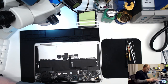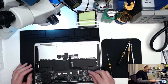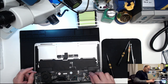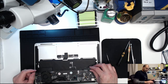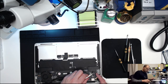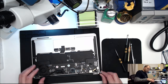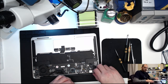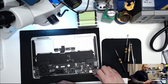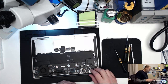Take the battery out - we'll be transferring it to the new top case. Pull your trackpad cable - there's a little latch you just lift up, same on the trackpad side. Lift it up, pull it out, set it aside. Undo your keyboard backlight cable the same way - flip the latch up and pull the cable out. Your right speaker is plugged in here, so unhook that. Then you have your LCD connector ribbon cable down at the bottom - pull that latch up and pull straight back to unhook it. Don't pull up or you'll damage the connector.